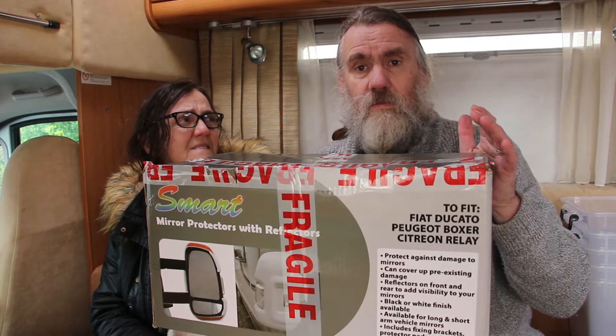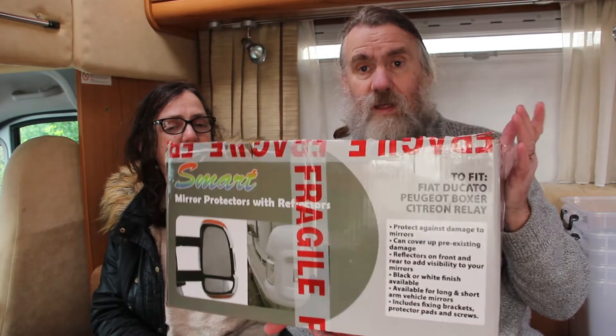We've decided to put some mirror guards on — these were £49.99 from eBay including postage and packaging. We've watched people installing these on YouTube and a lot of them seem to be struggling. I'm no mechanic and I've never replaced one of these in my life, but I watched a lot of YouTubers and almost all of them pop out the mirror to get to the screws. There is no reason for doing that — all you need to do is push the mirror in so the screws are showing, then use a small Phillips screwdriver and the lens just pops out.